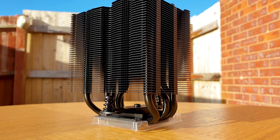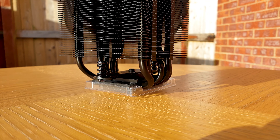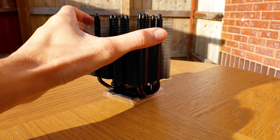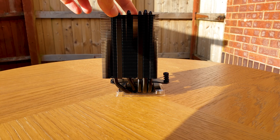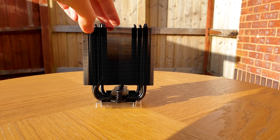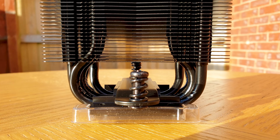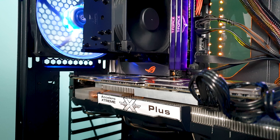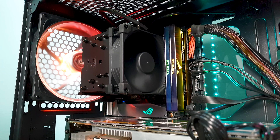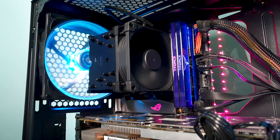It's a well-known fact that the original U9S is one of the best 92mm single tower CPU coolers out there, and today I've reconfirmed just that but with the new paint job. It's such an efficient and potent little cooler given its small footprint that it's the go-to choice for anyone looking for a heatsink under 130mm that guarantees zero headaches regarding RAM, VRM, and GPU compatibility around the socket area. This is meant for small form factor machines, so it's understandable that overclocking headroom is limited, but it's a clear upgrade over stock AMD low-tier coolers and a clear choice over the popular L9A series where space permits.